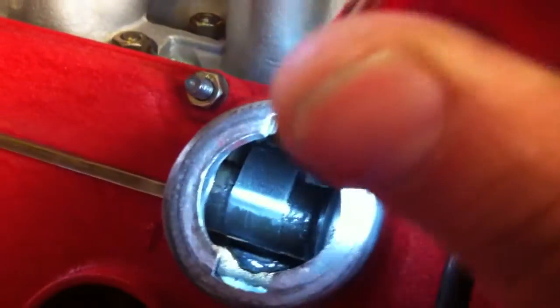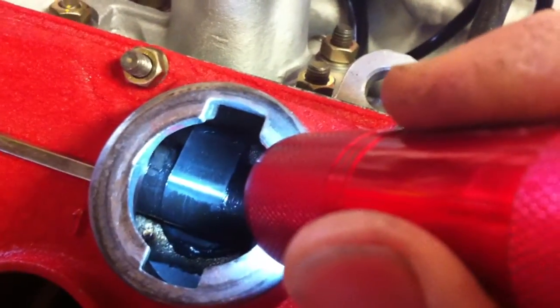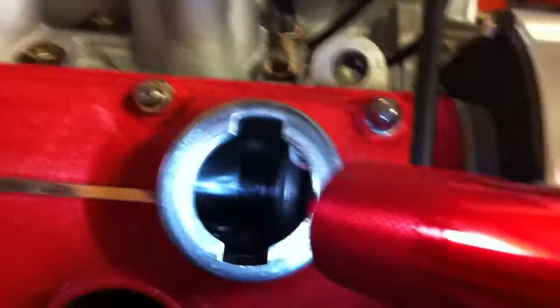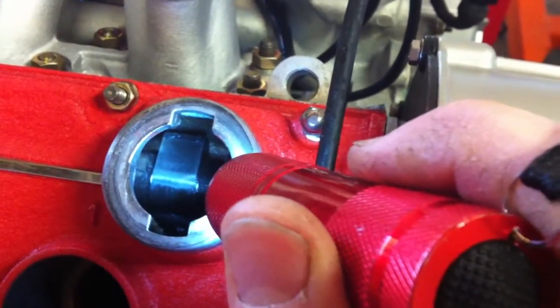So let's go one more time. That's a little bit past top dead center. You can see the intake cam lobe is pointing forward, so that valve is closed — so that's your compression. That's top dead center on the compression; the lobe is pointing forward. There you go.